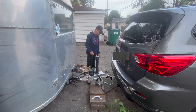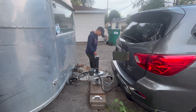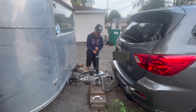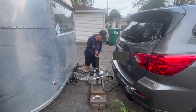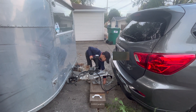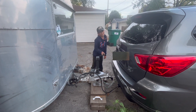The second thing — you want to have a wooden plank or something to hold it down. Get your handle and lower your jack down. Watch out to see if anything's in the way. Once it's snug, you want to disconnect it from the car.